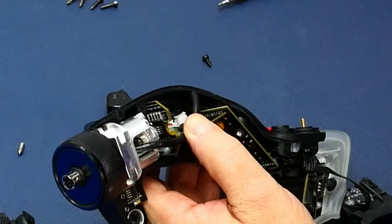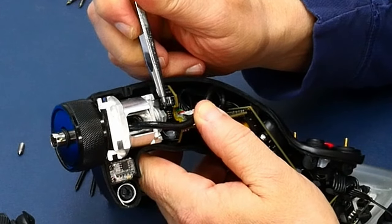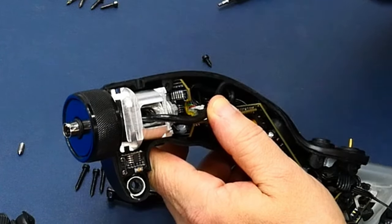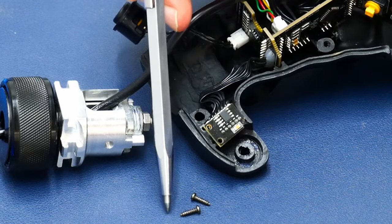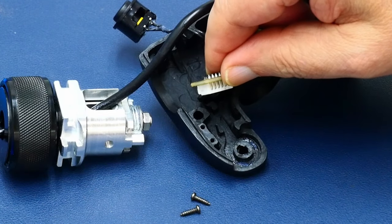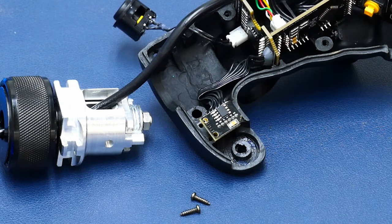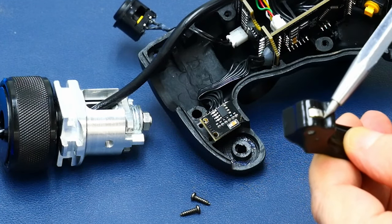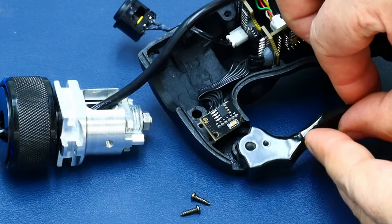Now you can see inside - here's the twist mechanism. In here is the magnet located with that axis, and then here on the PCB is the hall sensor for it. The last part here is another hall sensor down here, screwed in with those two screws. It has on the bottom a little mounting standoff for a pedestal, and this one is responsible for our brake lever. The brake lever has a magnet right here, fixed in there, and that hall sensor picks that magnet up when we activate our brake lever.